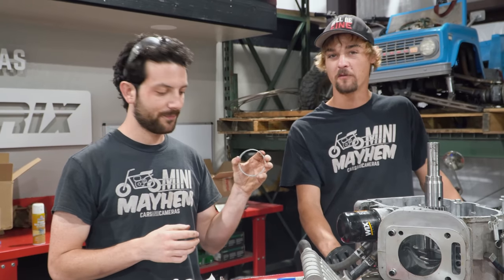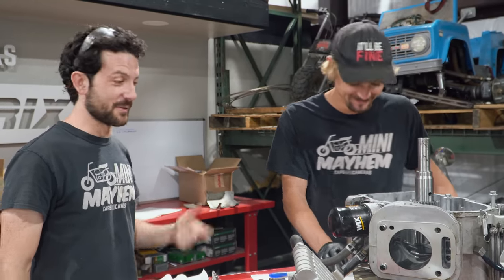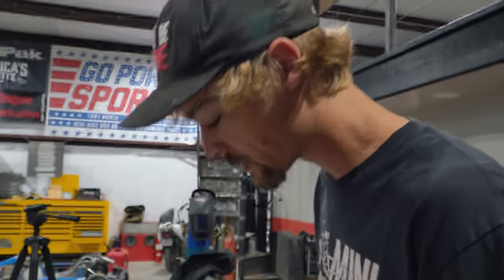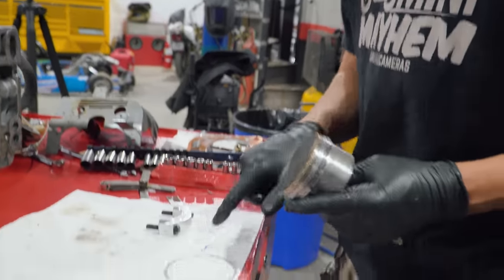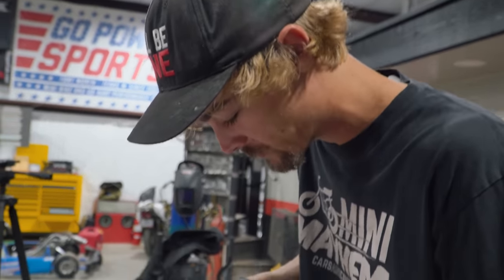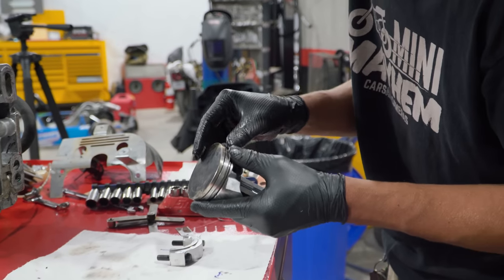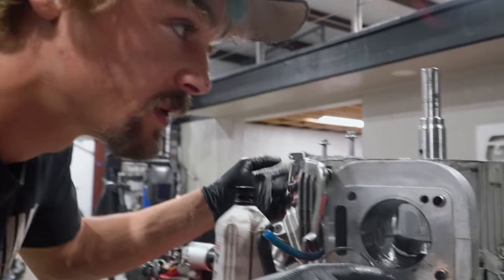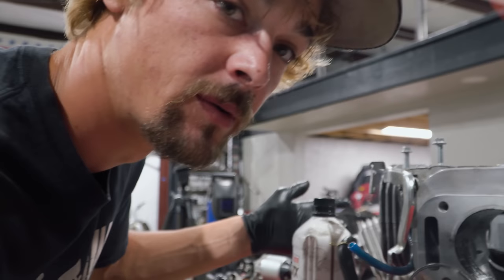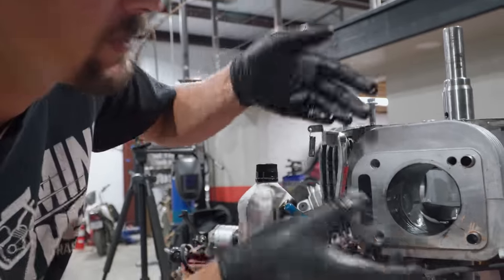Your desired ring gap is going to depend on the bore of your cylinder as well as the application. I took numbers for a drag racing situation with forced induction. We'll get these rings one at a time in the cylinder. We don't want an unscheduled rapid disassembly — this rebuild was unscheduled too, but not so rapid. I'm removing the second compression ring and have them labeled one and two so number one is the top one. You definitely don't want the two gaps on the same side of the piston. The top ring was 10 thousandths, the bottom was 24 thousandths, and the oil rings are in spec, so the only one we need to modify is the top ring. On to cylinder two.